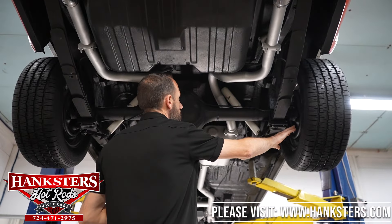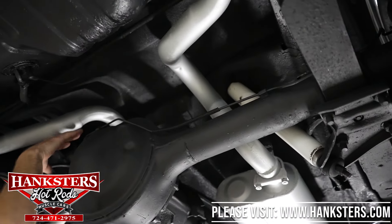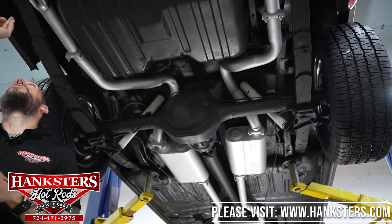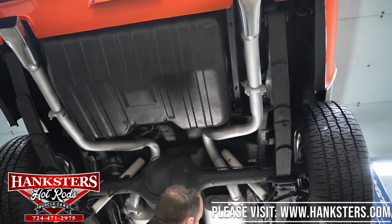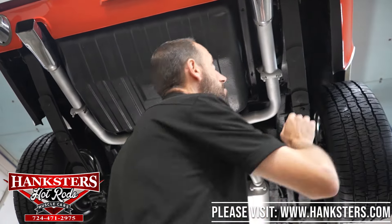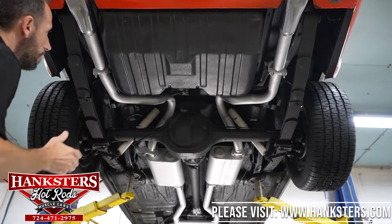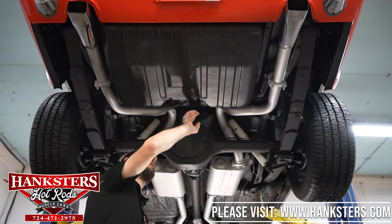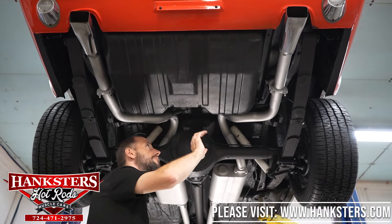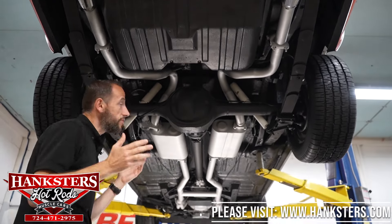Like I mentioned we've got drum brakes on the back. Our floor up above the differential looks really good - all your lines, your fittings, your stampings are all present there, that all looks really good. Our rear sections of frame look good. Our rear spring hangers or shackles look good. Our fuel tank looks really good - it is painted in black. Remember on this model year of Mustang your tank is part of the floor up there, that's why you don't see straps. All in all it looks really nice under here. We're going to drop this down and fire it up to hear the engine run.